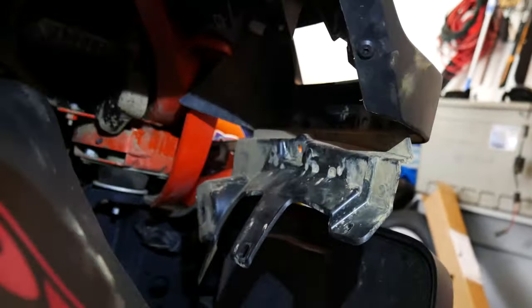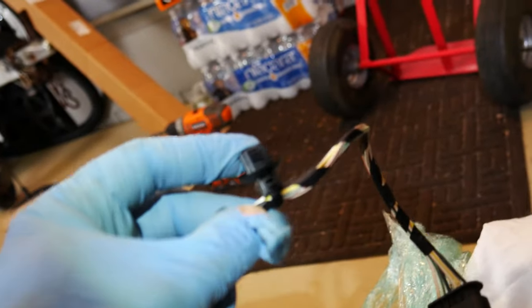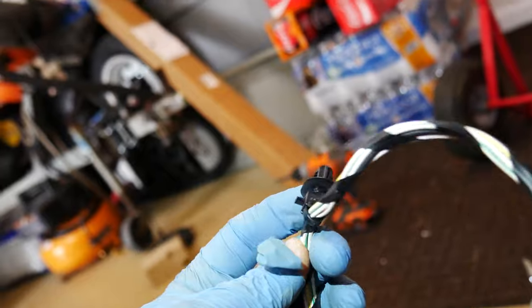So we've got one down. I'll put the other light in there, run the wiring harness. So the wiring harness is there. As you can see, this was kind of taped in there. It has this little clip. You can't reuse this one. So you can either order some. I'm just gonna use some zip ties along here. There's plenty of spots for me to use zip ties and put that other one secure. Plus, remember the liner goes in there. Yeah, so it'll keep it all nice and tight in there. So let me run the other one, put the light in, and we're good to go.